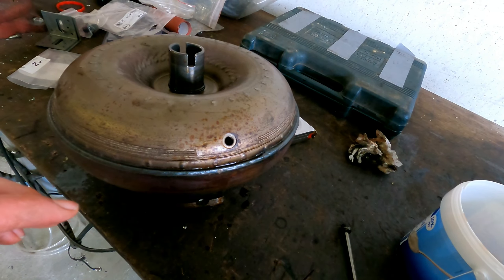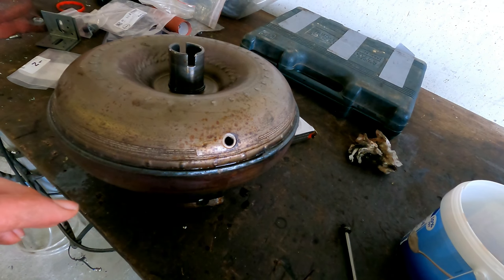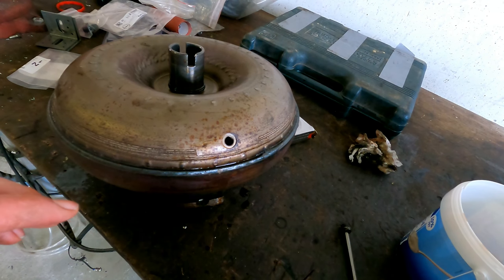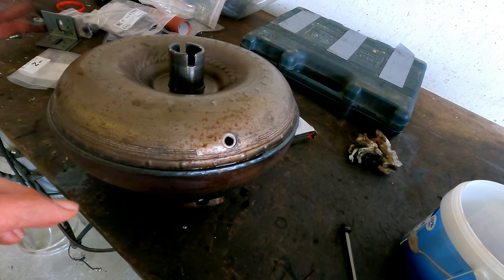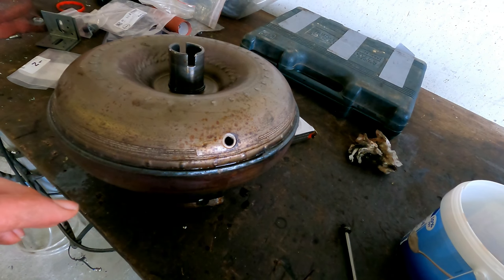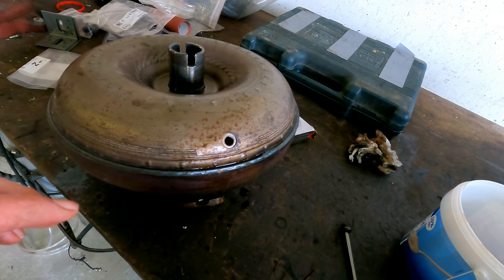What I'm thinking of doing is removing this piece entirely, since I can't connect it to anything — it's going into a W124 which doesn't have that cable. So it will not be locked in park mechanically. The connector on the side has two rubber seals that always start to leak, so we're going to change those. Before you take the valve body off you have to remove the connector.